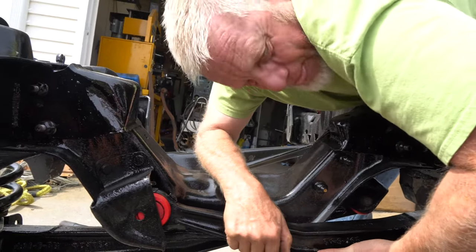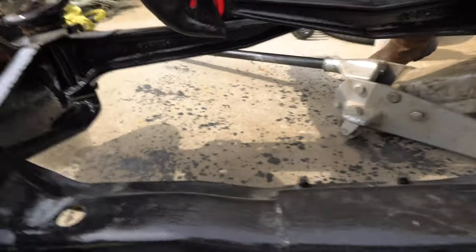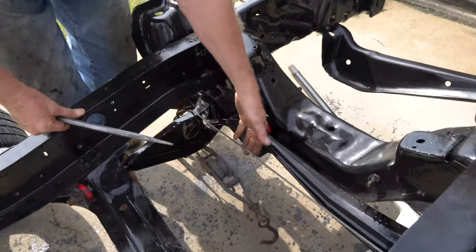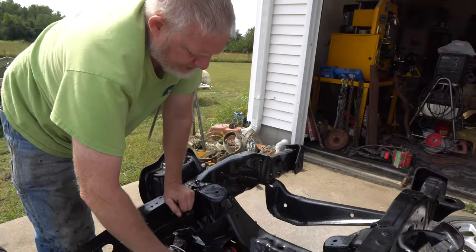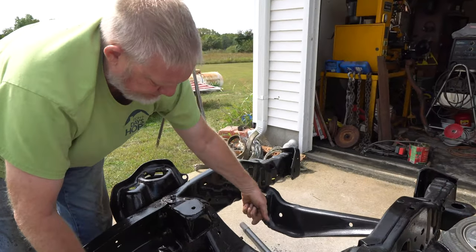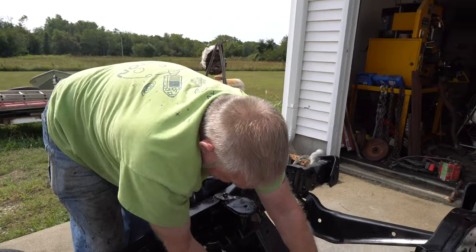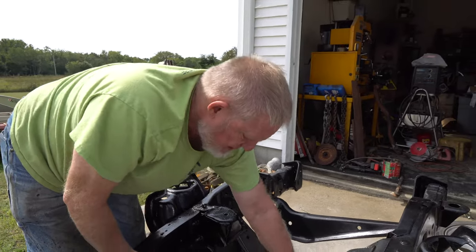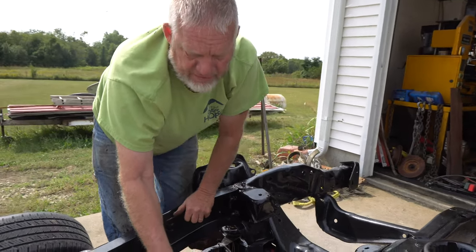You're almost there — I can see the outside race of it. We may have to get a couple of pry bars. It was a bit of work and it ended up taking both Joel and I. What we did was we put a come-along on here because we had to bring the arm in. Then we used a pry bar to line this up, brought the bolt in from the other side, then used this pry bar to push down to get this lined up, and then just kind of worked with this cable to get our hole lined up, and Joel tapped the rest of it in. So now we're in place and we'll finish getting that tightened up and this bushing on.